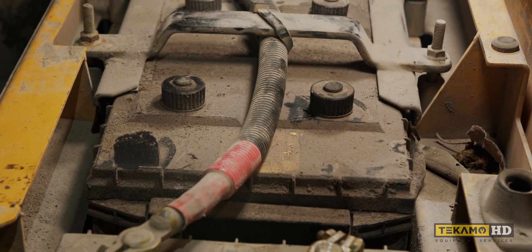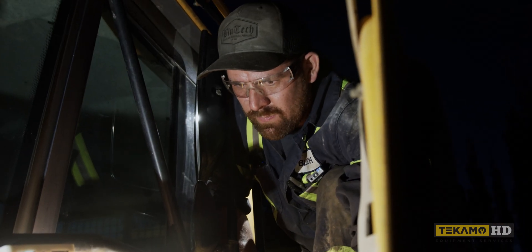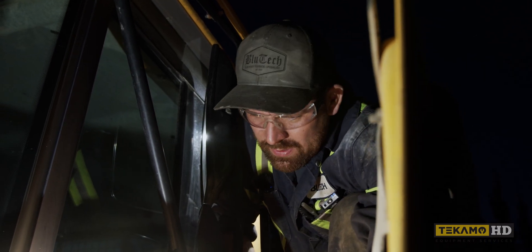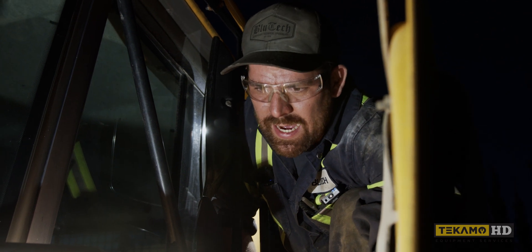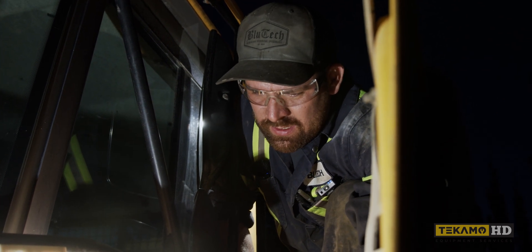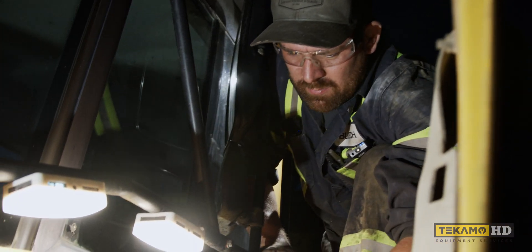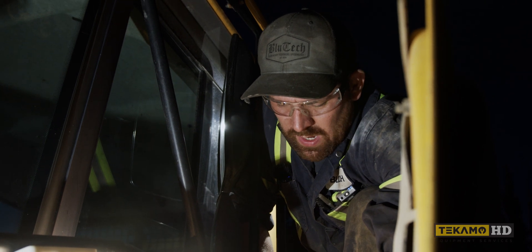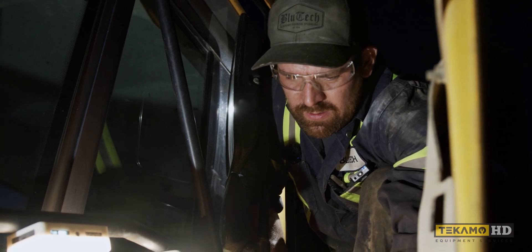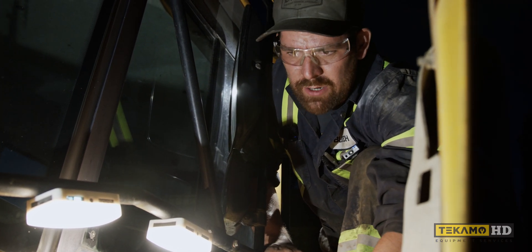Take batteries seriously — it could mean your life. I'm not even going to bother going further on this, because batteries can be dangerous. They can blow up — it's the hydrogen gas that builds up when they're working under load, cranking and all that. It'll vent out, and all it takes is a little spark. You've got hydrogen gas coming out, and that loose terminal was rattling, makes a little spark, and then your batteries blow up. That is definitely a risky situation. So we're going to avoid that — I'm going to get new batteries, put new batteries in, and proceed from there.